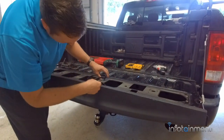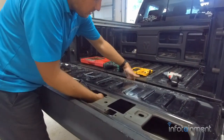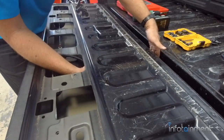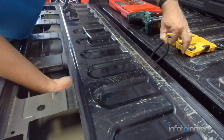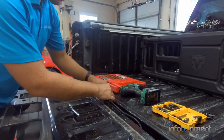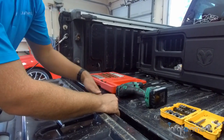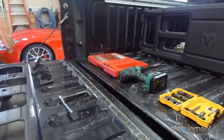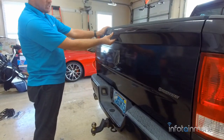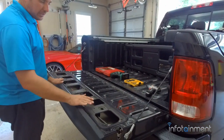Now we're going to take our wiring and stick it through the hole — there's a pretty big size hole right through here and we're going to fish it to the other side. Then we can route it down in this hole here, where we can easily connect the loom underneath where the spare tire is. Before we put the back part of the tailgate on, you're going to want to test to make sure the new handle works — and it does. So now we can put that plate on and reinstall the eight screws.